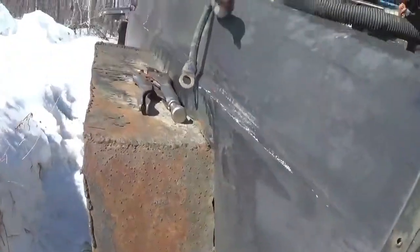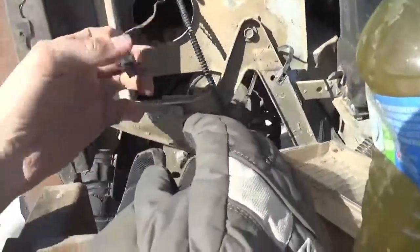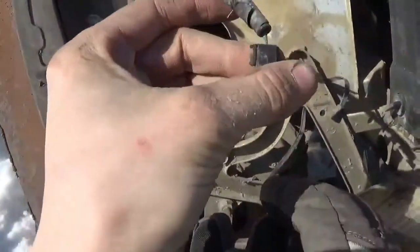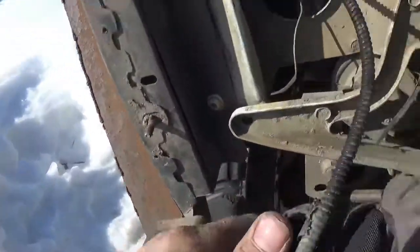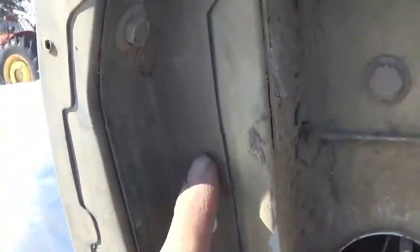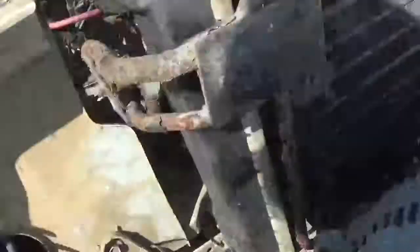The other thing we're going to do — a while back I hit a tree on this corner, and as you can see the fender buckled in a little bit. Ever since then my headlight has been pointed down. This is for my fog light. The horn should come out a little bit more. Back to the fender and the headlight thing — this headlight has been pointed down, I've adjusted it up but it's not enough. You can see this bracket right here where this frame is bent in — I'm going to straighten that out a little bit. The AC rod is all in there, I got to attach that back down. You can see how this side is nice and square and that side is not.